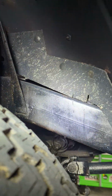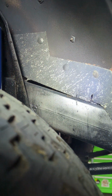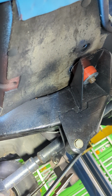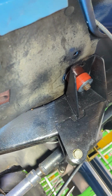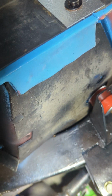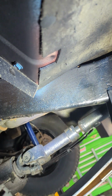And then in the back of the wheel well, the front wheel well, you've got this close-off piece. It's the same piece left and right again. Underneath here, you've got this piece, which I believe is also the same piece left and right if you just flip it over. This has to be installed when you install the body. It goes around the body mount there. It goes above the fender, and then it goes below the wheel well. It's held in with 2 push pins.